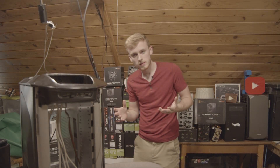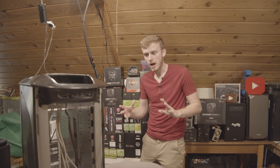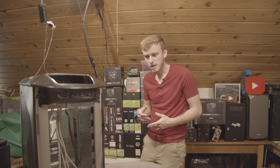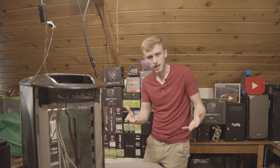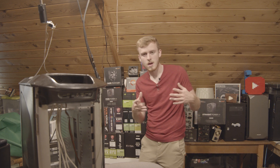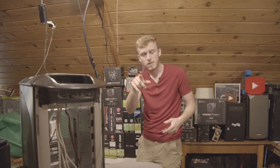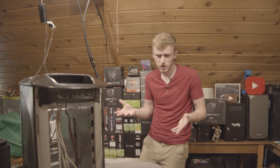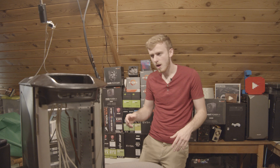The next thing to finish updating this a little bit better — obviously if I had a little more budget for this kind of video I'd also add some USB 3.0 ports. All I had on me was that USB-C, and honestly that's all I really need since I mainly needed USB-C or 3.1 for my camera. If you're doing fast transfers or have different media that needs fast access, get the one with USB 3.0 instead. I'm also going to add some fans — fans are important because this case is missing some and the existing ones are pretty old with wiring that's gone on them. I'll update those as well and then we're kind of finished up with the updating part.